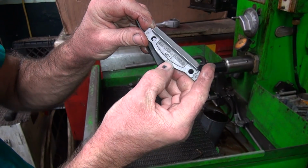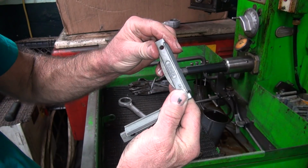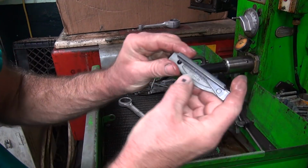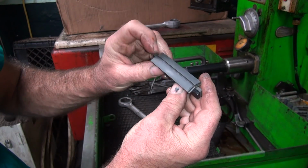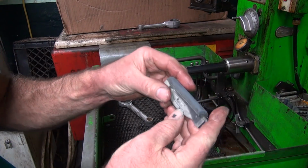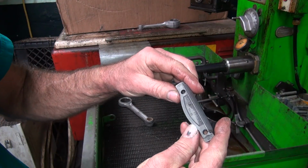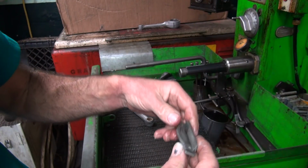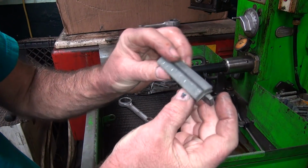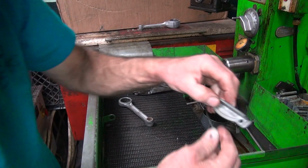Alright, see, I ground this as being number 1. That goes on my rod hone. This one's not ground, so it wasn't for a rod hone, it was for something else. Now it's mixed up. This one's got one mark. That's a 95. That's super fine. So I don't have my medium here. This has 2 marks, so that goes on a different mandrel. This is another 95, unmarked. Here's a CR2 with the 2 marks on it. So that goes over there.